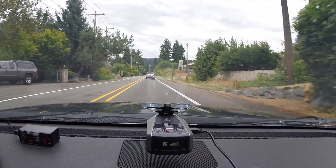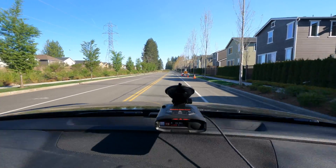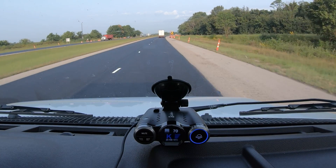Speed signs are super convenient — they're already set up on the side of the road, you don't have to buy another radar gun or set anything up. So if you see anything weird with your detector, it's good to know that speed signs are not the best thing to test against. A lot of speed signs transmit on K band, so make sure K band is enabled and avoid using narrow segmentation options — set it to sweep a wide or extended frequency range if your detector offers that. Some speed signs transmit on X band, so you could try enabling X band or disabling some filters like TSR, BSM filters, or K filters for testing purposes.